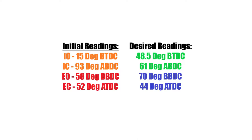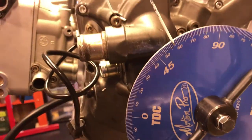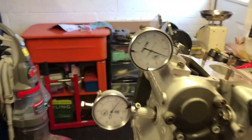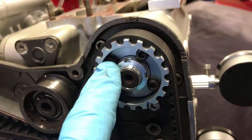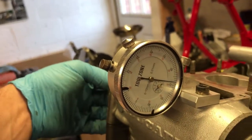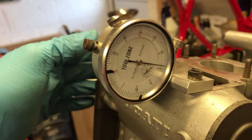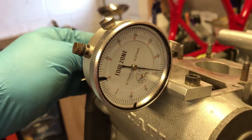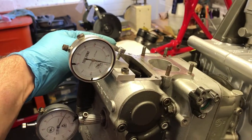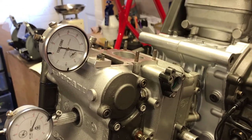The easiest way to do this is to turn the wheel through a normal cycle and put it to the position I want the valves to open at. I'll then unlock the adjuster and, using the nut on it, turn the cam through to the point where I get one millimeter of lift by moving the actual cam — not by moving the engine. That should bring us to the correct degree setting. Unfortunately I haven't got a tripod, so I can't film this, but I'll make the adjustment and show you the result afterwards.